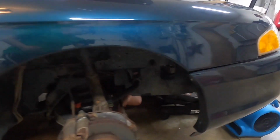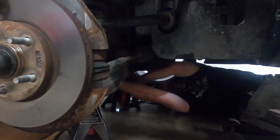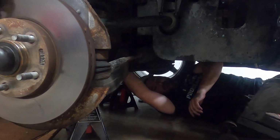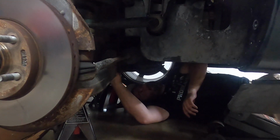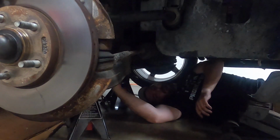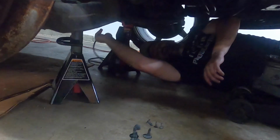Down underneath, we can get rid of this stock oxygen sensor. We'll put this in. Now, I prefer the driver's side, but it's up to you. You could also do the passenger side. Sometimes it's best to run on one side, tune the car for a while, move it over, see how things are looking, and go back and forth. Or you can add a second. The Terminator X doesn't support two, but you could data log a second one inside the Terminator X. Okay.